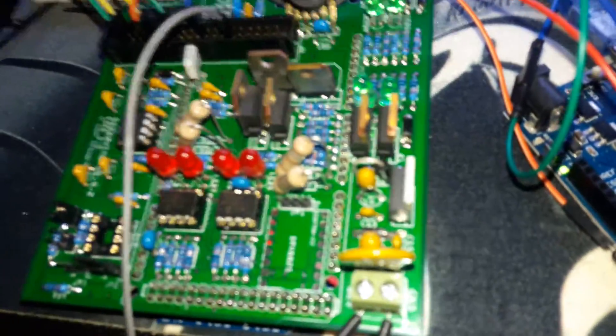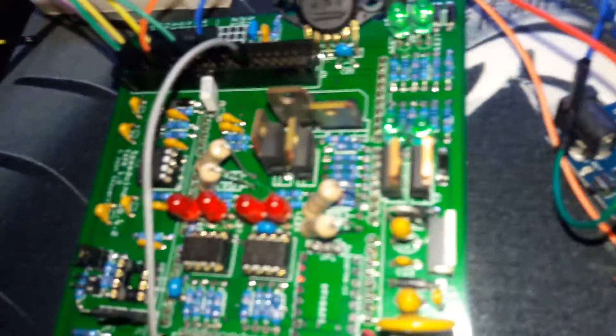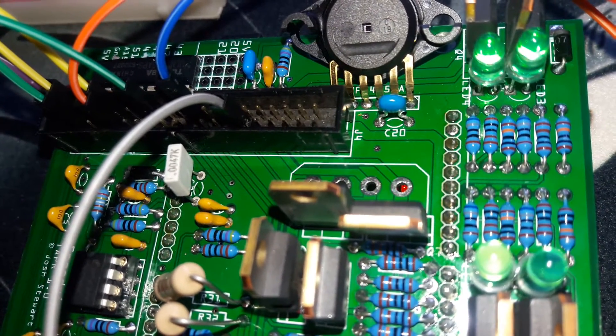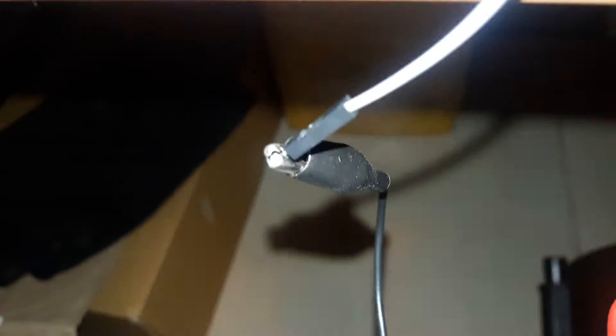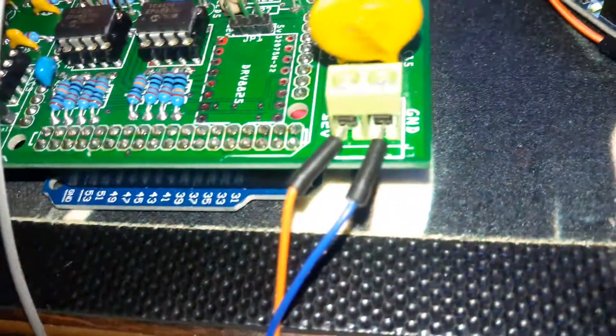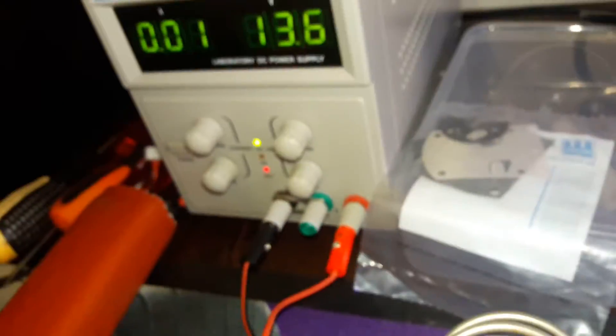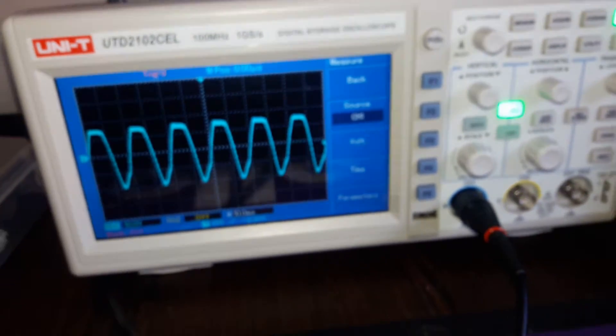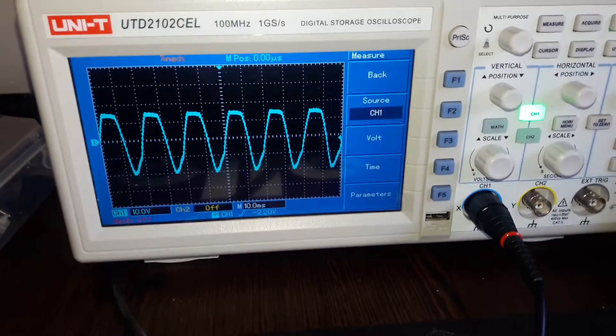We're back. We've uploaded the new February firmware onto the Arduino. We're running pin 35 — you can see there: 40, 39, 38, 37, 36, 35 — on the gray wire going to the ground of the scope. The positive of the scope is connected to the 12-volt supply, sitting at 13.6 volts — that's the reading we've got on the scope at the moment.